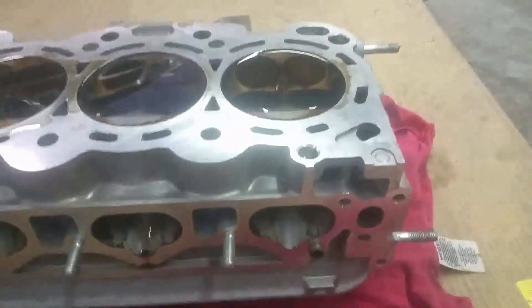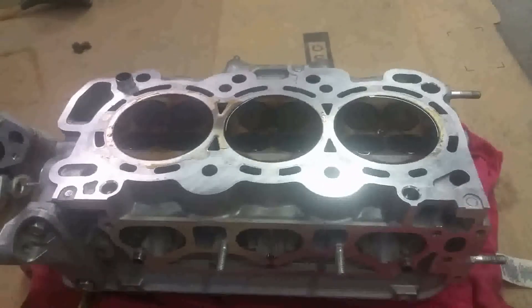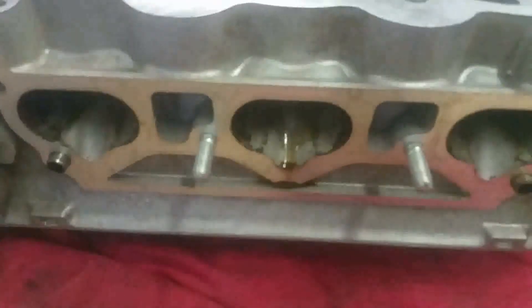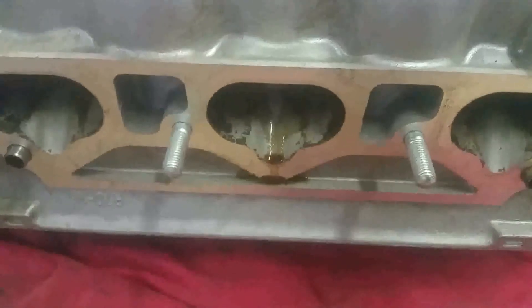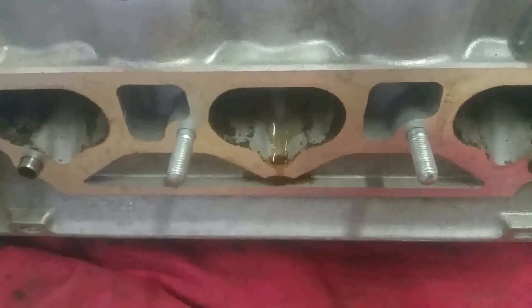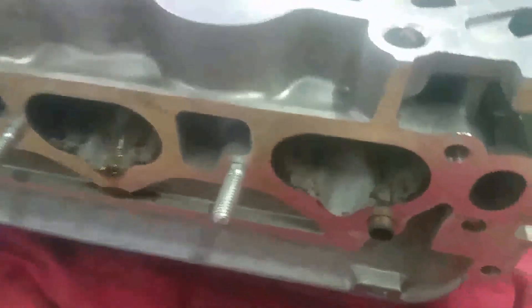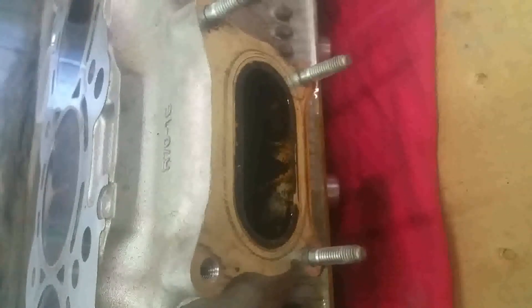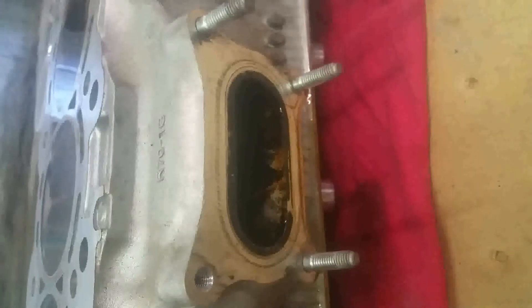But that is what happens, so we are actually going to overhaul the head and in my next video I will show how we are overhauling the head — we will replace all the intake and exhaust valves and we will also lap them in and check for leaks. But this is the first sign — you can see that cylinder number 5 intake valve is faulty and it is definitely seeping through. When the head is on the engine, imagine all those hot gases just coming right through — it causes misfire and you lose compression. Number 6 is still holding but it will eventually give. Or it could be coming out through the exhaust. Look how wet my exhaust is — all that shiny area is my thinner making it through the exhaust. So my exhaust valves are bent, because most likely when the vehicle was in an accident and was hit on the passenger side, my timing belt slipped a couple of teeth and on Honda engines that usually bends the valves.